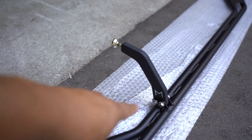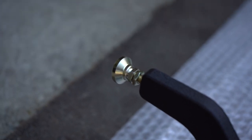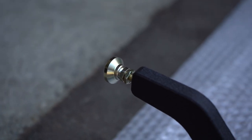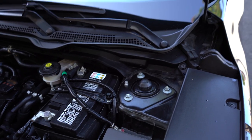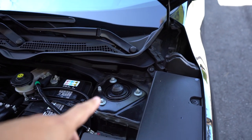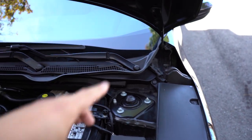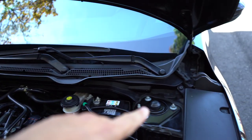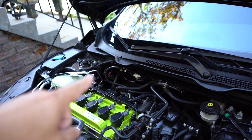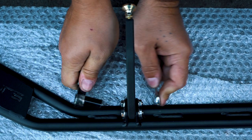To install the brake cylinder brace it's pretty simple — it's a two-bolt design. What you're going to do afterwards is adjust the nuts right here. You see there are two nuts there — you're going to have to adjust that to your brake master cylinder so that you can put enough pressure on it properly so it's effective. Then we're going to release the three bolts on each strut. That's why it's called a strut bar — you're using the existing strut hardware to mount it. That's going to tighten up the chassis of the car. You'll need a 10mm socket or two 10mm wrenches.